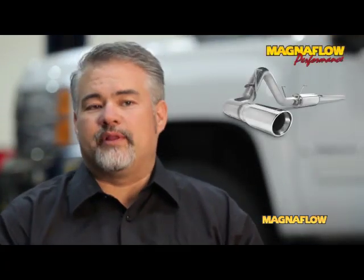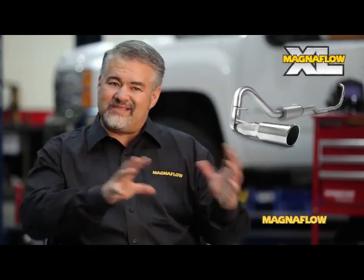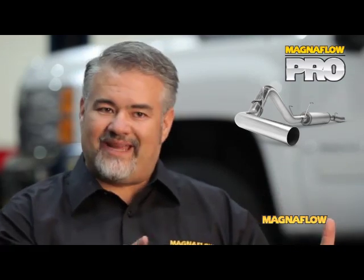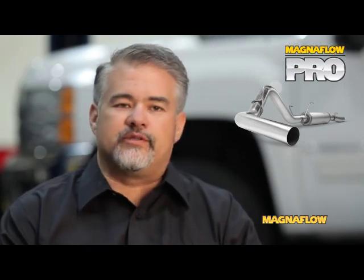Our three traditional systems here at MagnaFlow that everyone's familiar with are our MagnaFlow Performance, the XL, and of course the Pro. The differences between these systems vary from not only the finish, but the actual materials that are included. The MagnaFlow Performance line is our top-of-the-line series and effectively has a dual-wall welded-on tip as well as a polished muffler. The next step down, our XL, also gives you a tip, but this is a single-wall clamp-on and as well has a different finish. We've gone with a satin finish muffler. Finally, to round out that three, we have the Pro Series. And the Pro Series is a system with a satin finish muffler like the XL, but does not have the tip, which provides a little more value or an option for that person to select the tip of their own choice.